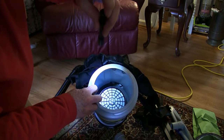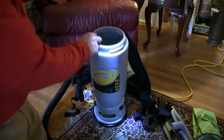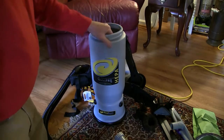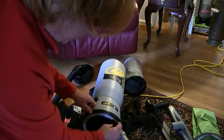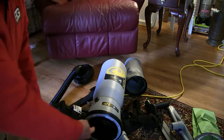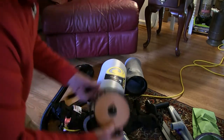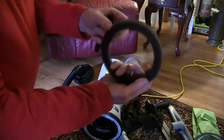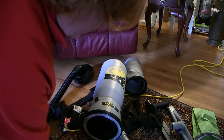You can see the HEPA filter in there — that's removable and you can clean it out. Don't use water on that one or you can ruin the elements; you can tap it to clean it. The cloth filter can be cleaned with water. On the bottom of it, it's also got a final filter system that filters the air before it discharges. It's got some foam filters and a ring filter as well, so the filtration in this machine is really quite impressive.